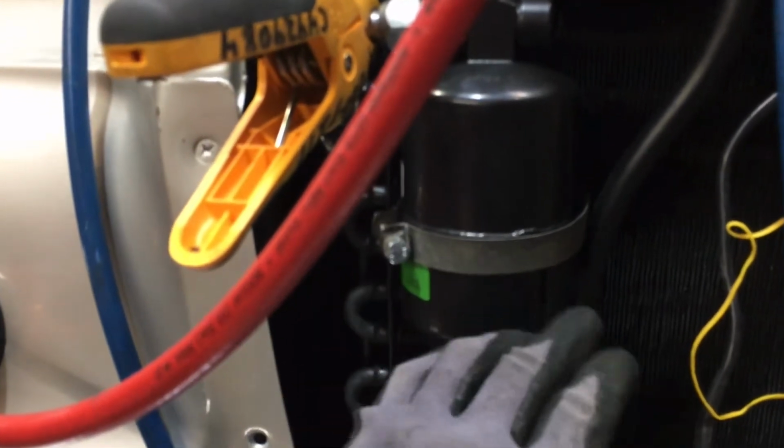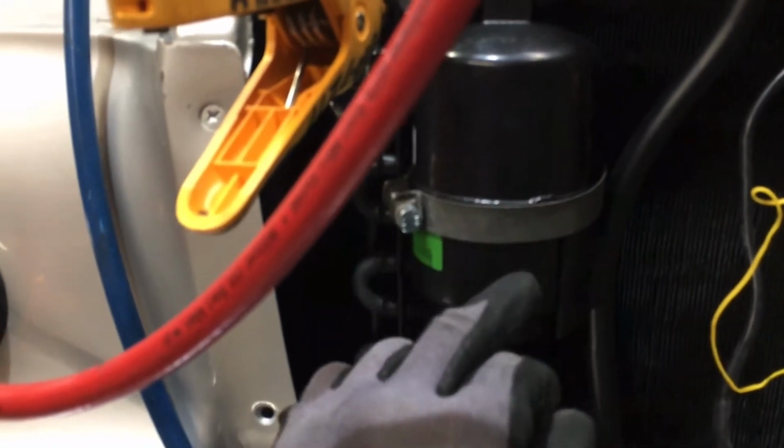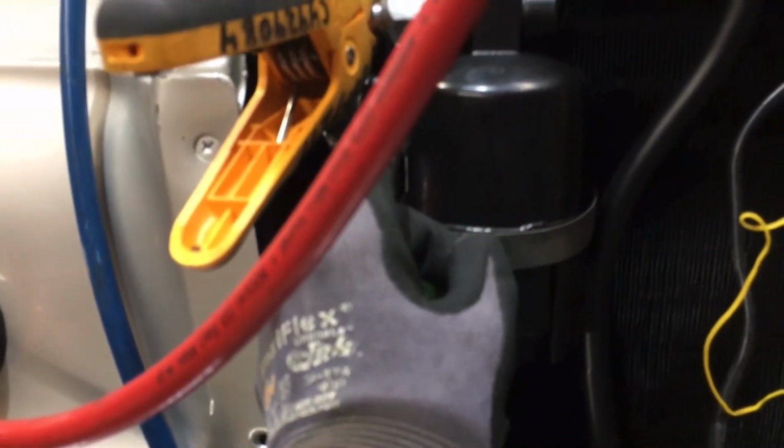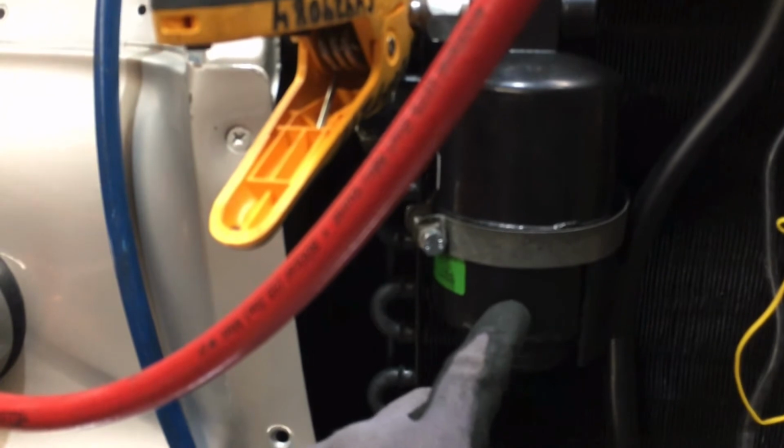It's falling into the top of this tank, and in this tank, in the middle, there's a metal plate, a screen with holes in it, and a filter pad. And then just below that is the desiccant BBs. And then there's another filter pad and another metal screen with holes in it. Then that refrigerant that is semi-liquid that contains oil goes through the filter pad, through the desiccant material, and out through the other screen at the other side, drops into this lower portion of the receiver.